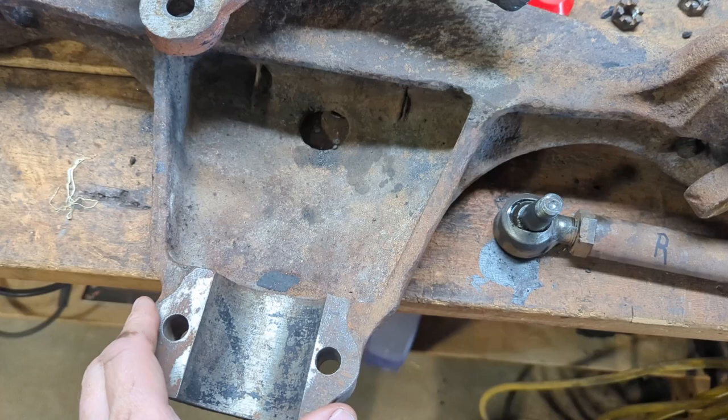I don't know — I may have to look through and find out if you occasionally had to take these off and grease them, or if they just didn't need much grease. Anyway, we've got the paint on it. I've got the new polyurethane grease covers on it. I ended up replacing the castle nuts rather than plating them. I went through and cleaned these up as best I could — didn't want to remove too much metal. Interesting thing: this whole assembly pivots on these two points but there's no grease zerk in there, so I guess I'll slather it with grease before putting them back on.